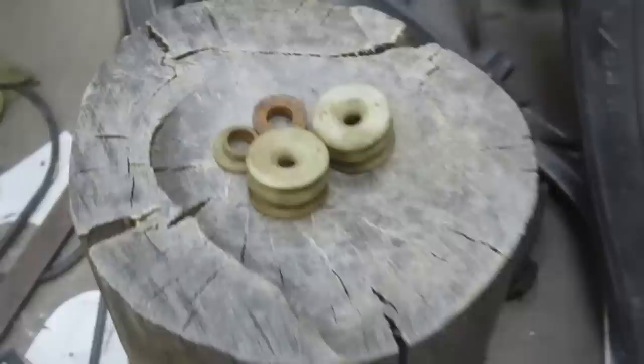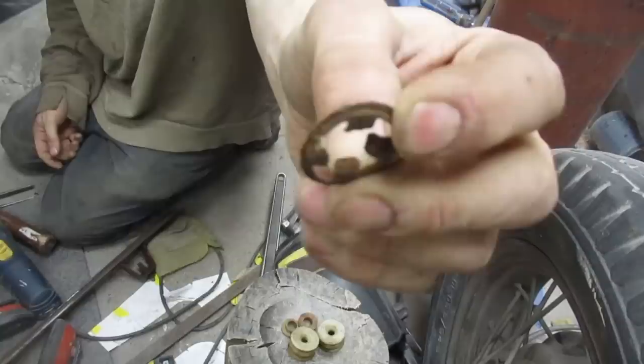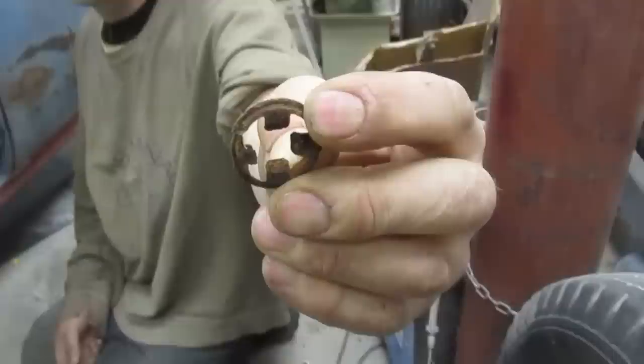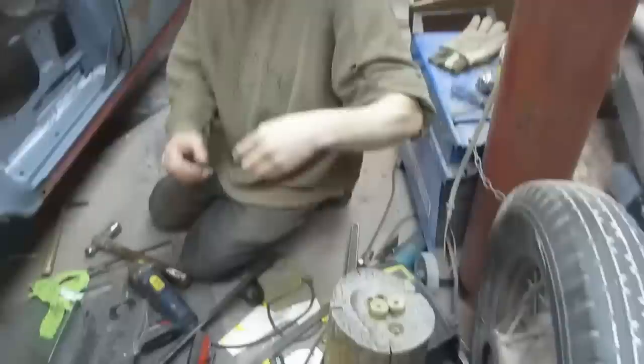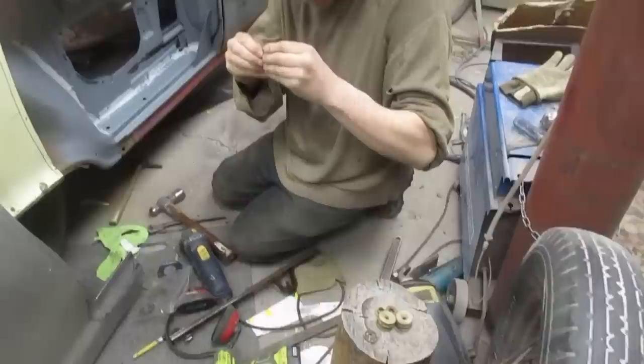I haven't got all day. Okay, there's the clips. Oh, the clips you saved. Yeah. Good. Look at that guy, eh? That one's in poor shape. Corrosion. What do you think? You're the engineer. You sign off. Yeah, there's a couple hanging. There's a couple adjacent ones that I think could do the job. Yeah, that's good. I think that third one, or fourth, is probably redundant. Bend it in? No, don't bend it at all. You don't think we could preload these other three a bit? Yeah, the only thing saving it is that it hasn't been touched. You've got one more install on it before it just gives up. So janky, eh?